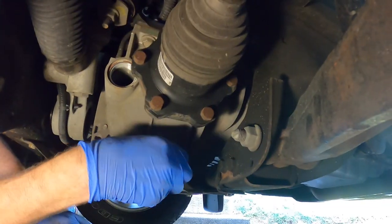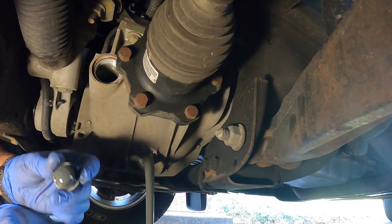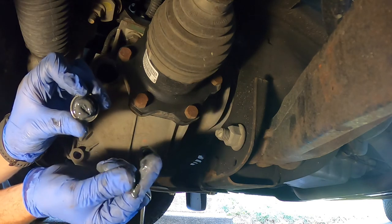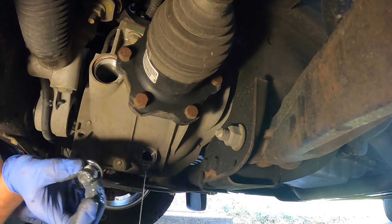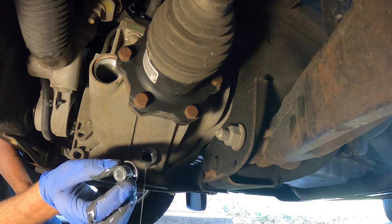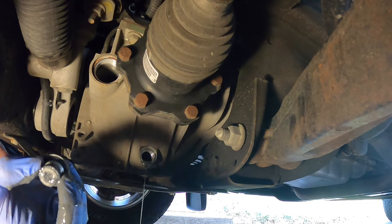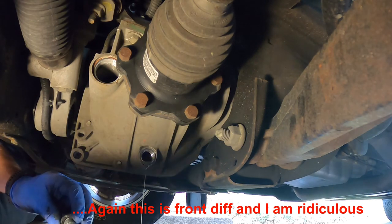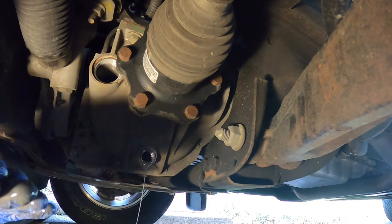This time it should get fluid — and there we go. So this is our drain plug, and it's magnetic. All that is the filings. More than likely I'd just about guarantee this has never been done before. I bought it before 60,000 miles, so I highly doubt the dealer did it even though I bought it used. But it's normal to have some filings on here because that's what GM calls break-in. We're going to have the same thing with the other cases as well — such as our automatic transmission, our rear, and our front differential, this being a 4-wheel drive. So we let that drain out; it's already getting pretty close.